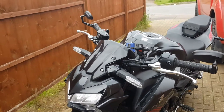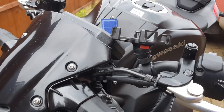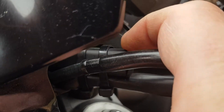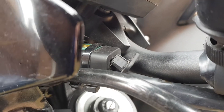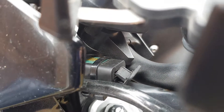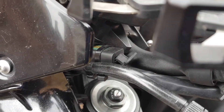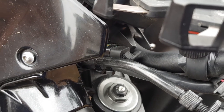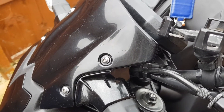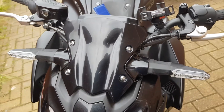Moving up the bike, the second modification you can barely see — I've put a USB charging point hidden in amongst the wires. In there is my USB charging point. I've done it with a thing called a USB tender, just zip tied onto the cables that sit back there. A USB tender gives power to the device you're charging only when it needs it — if it's at a hundred percent, it stops charging. It's only a single port but that's all I need. The alternative was one of those big chunky things that sits on your handlebar with wires hanging out the back, and I hate anything hanging off my handlebars. So that charging point tucked away out of view is absolutely perfect.